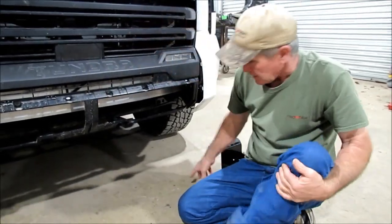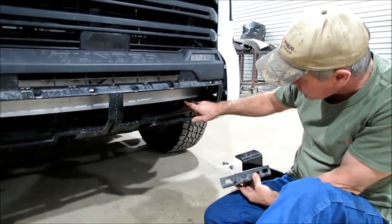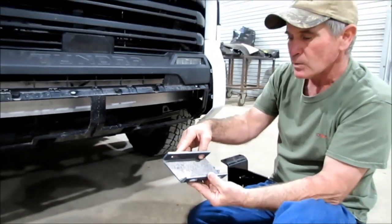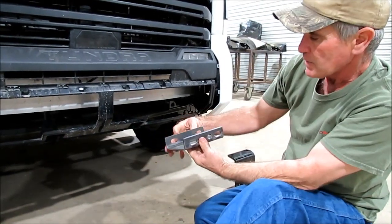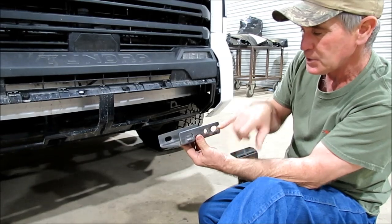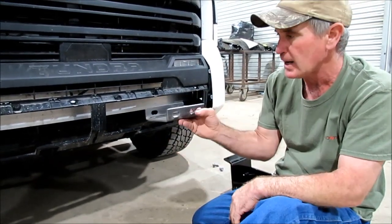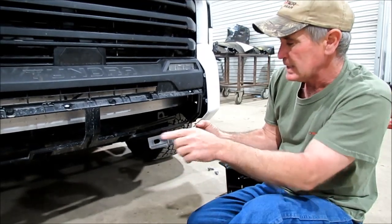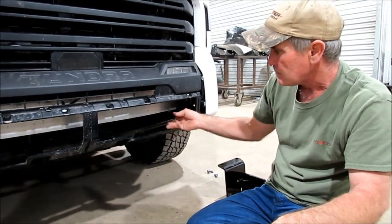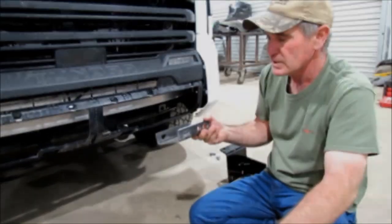Next, we've got our bottom brackets that are already on. There are two bolts that attach the crash bar to the frame right there — those two bottom bolts need to come out, and this bracket bolts up underneath there just like that. These two holes go against the frame. The one with the little round hole, we put that on so you can get a three-eighths extension through there to reach this bolt. This one you can get right off the side. Go ahead and mount that bracket first on each side and tighten it all the way. You can see how it angles to the inside of the truck. Move it side to side so the bolt is right in the center of those slotted holes, then tighten them up.